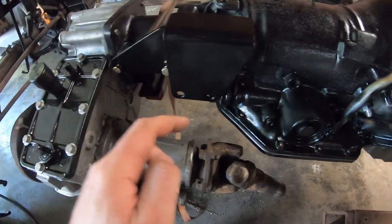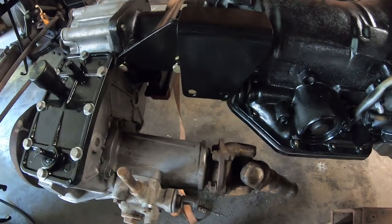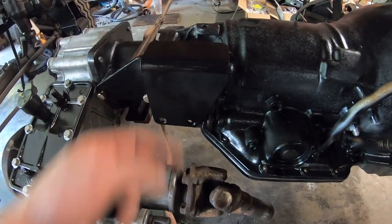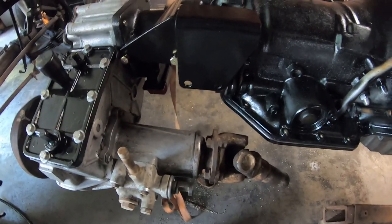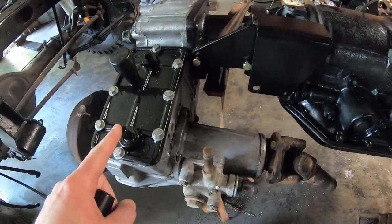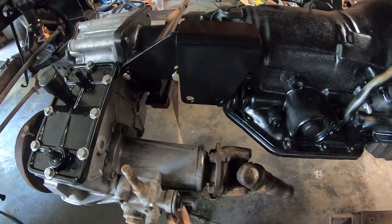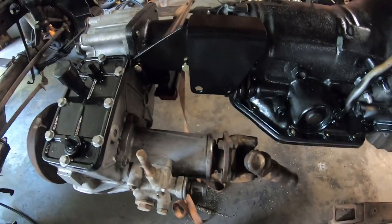So that's going to decide which side of your lever point here that your linkage rod is going to go on. Now, because of the heights, I'm kind of stuck with the linkage rod going back here. That's going to have to be on the top side of the hinge point. This one, though, it doesn't really matter. I could do it either way. So to start with, we're going to have to figure out which is four-wheel drive, two-wheel drive, and then which is high-low neutral as far as directionally. And then we can start designing the initial block and how it bolts onto here. That'll be a good start for us. So let's get going on that, and then we'll see if we can get this mechanically correct first.